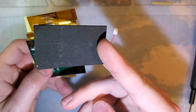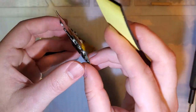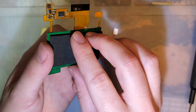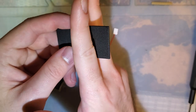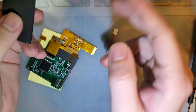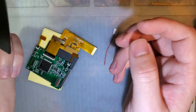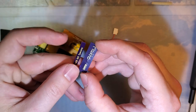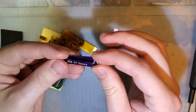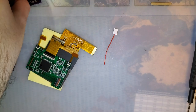You also have this big block of foam. I made this mistake in one of my earlier videos — this doesn't go on the back and doesn't provide spacing. How it's intended to work is you cut it into chunks about this wide, and use them to center the screen within the body of the Game Boy. I have made my own spacers and I'll post a link in the description. I'm going to use those because it's a lot easier and I already have a bunch of them.